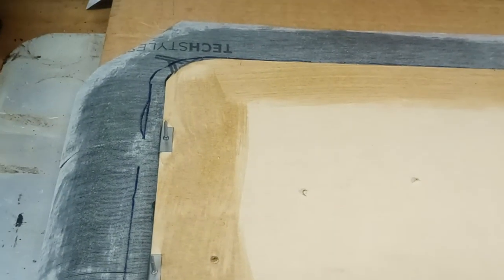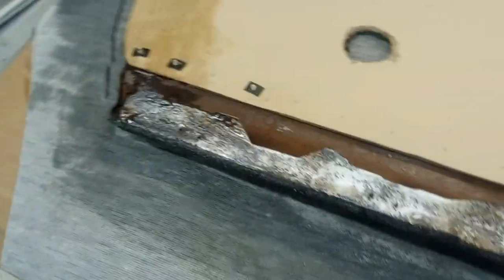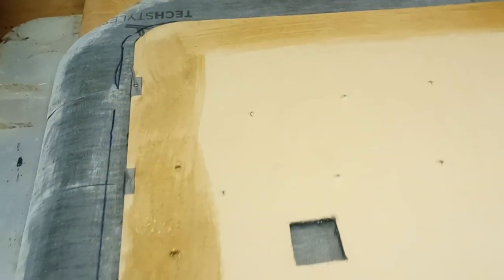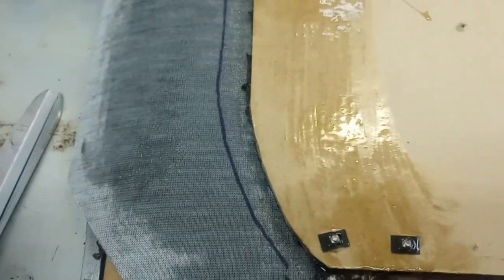You may have noticed I'm not exactly on my lines but that's okay — it's more of a reference point of about where to put the panel. I'm not an expert upholsterer, I'm barely a novice upholsterer. An expert would have measured everything to the right length. I gave myself a lot of extra room — this is a bit long, and obviously when it comes over I'm gonna have to trim it. I'd rather have more room to work with and waste a little bit than come up short. The fabric came in a five yard roll and I don't need the full five yards. Once this tacks up I'm gonna start flipping these corners up, smoothing them out, and then driving quarter inch staples in to keep everything nice and tight.